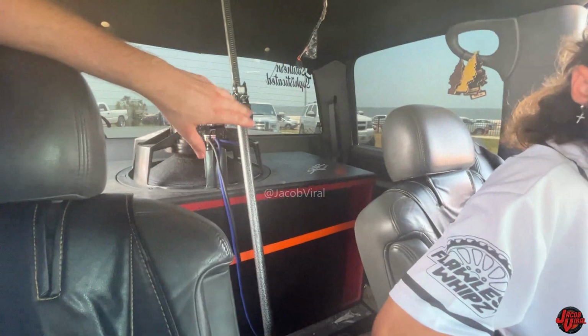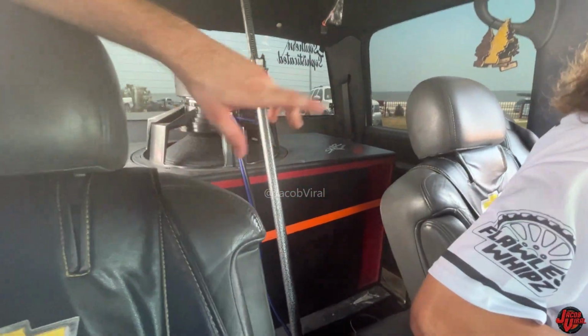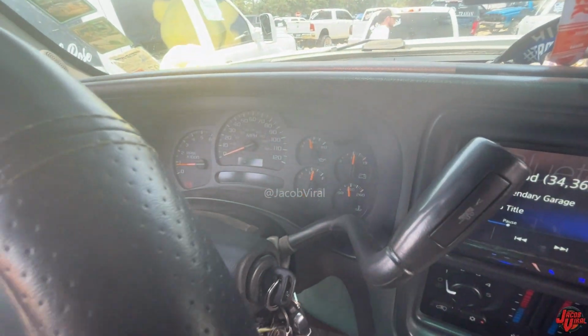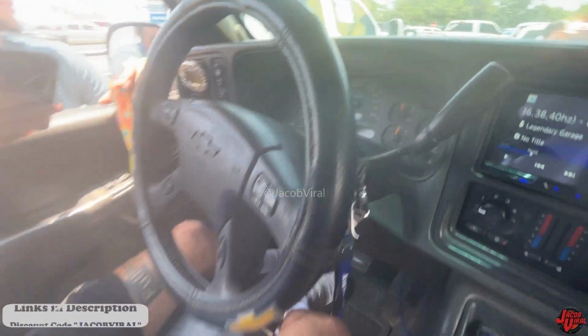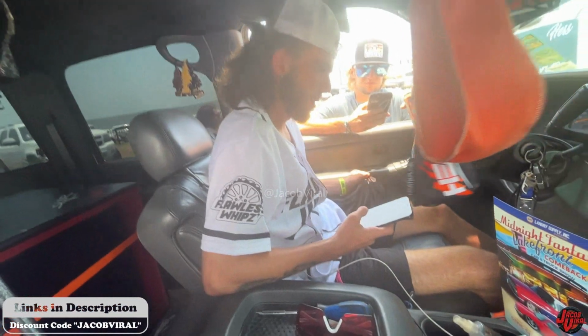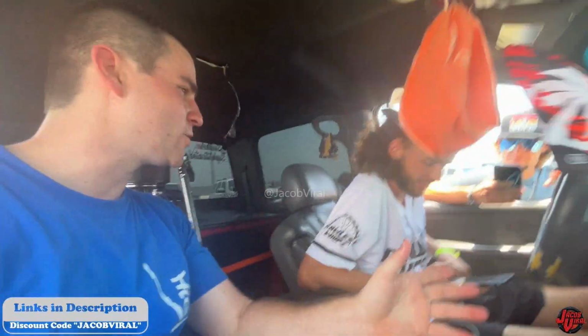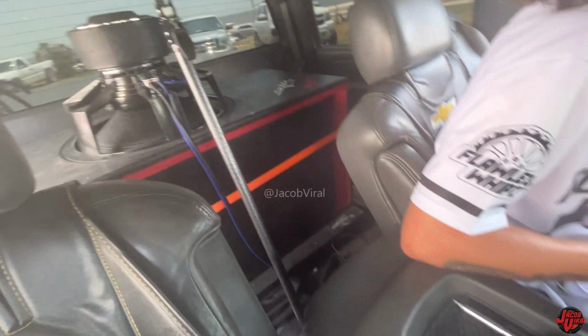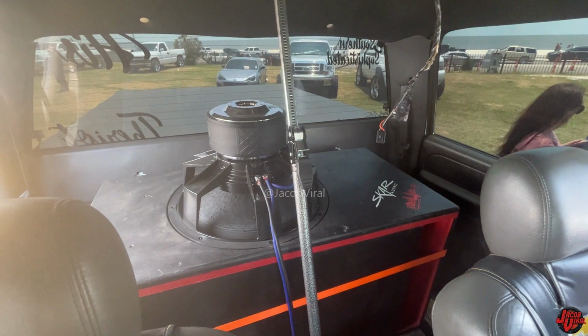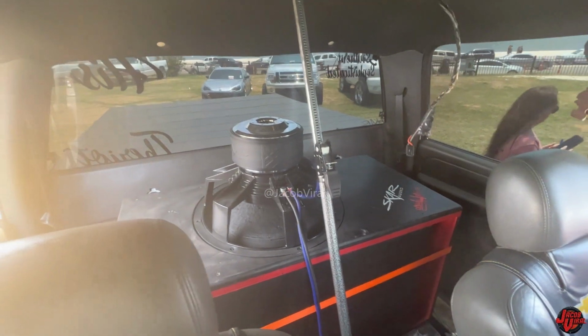So you said you're going to plan to upgrade your alternator because your voltage dropped bad. Do you have a voltage reader to kind of know how bad it was? It probably goes from about 14.4 to a little bit under 10. 10, really? 10s? Oh, yeah. Once you do the alternator, it'll help. Or if you do a second battery, it'll help too. Yeah, I thought about that. A battery would probably be more beneficial for battery reserve. That's up to you. Thanks for the demo, man. No problem. I like it. Yes, that's me. You can see my face right there. Yeah, man, I'd love to hear it. All right. Thanks for the info.